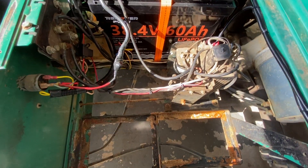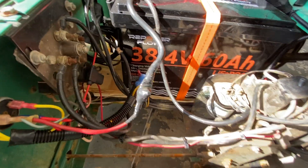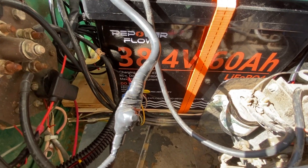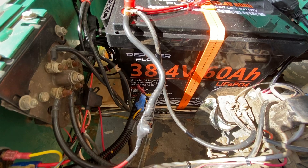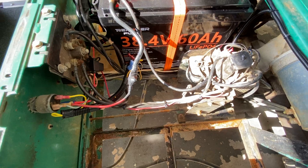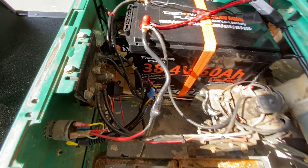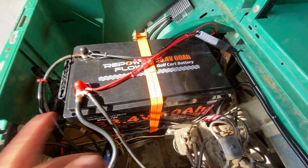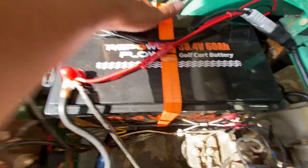Here's what I've done to make the battery safer and not have it ride directly on the metal brackets. I put a piece of three-quarter inch plywood underneath, cut to the width of the battery and about 20 and a half inches long. That piece of wood rests on the front bracket and the back bracket, giving much more even weight distribution so the battery isn't sitting on just the edges. It's blocked in front and back to prevent forward and backward movement, and with the supplied strap, the thing is rock solid.